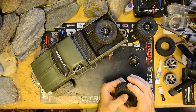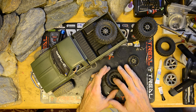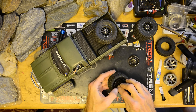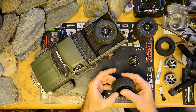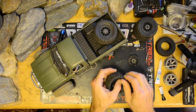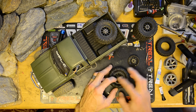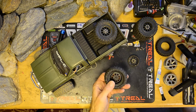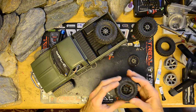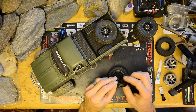Give it the feel test — see how it feels. Okay, now — what I almost forgot to do is get the inner ring back on the inside, which is going to pop right back in there. Making sure we're still bonded on the other side — yes, still in good shape. That means it's set up just fine. That was almost a mistake. This has two posts that need to line up with the wheel, so make sure your orientation is proper before you land it.